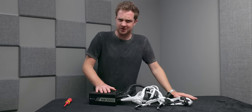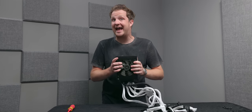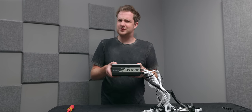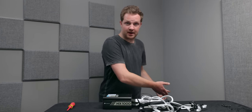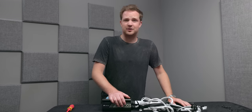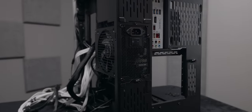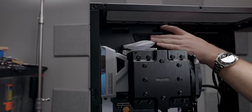The power supply can actually be a fairly major source of heat and noise inside your build, which is why I selected the Corsair HX1000 — a 1000-watt power supply. Yes, it's completely overkill for a single-GPU build with an i5 that we're not really overclocking much. I could do fine with 500 watts. But the reason comes down to load — the ratio of power you're consuming to what your PSU has available. The higher your load, the hotter the components inside get, the faster the fan spins, and the louder it gets.